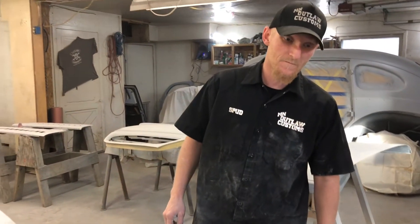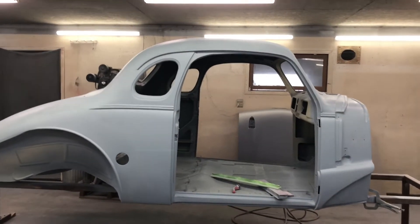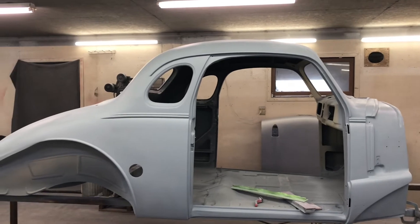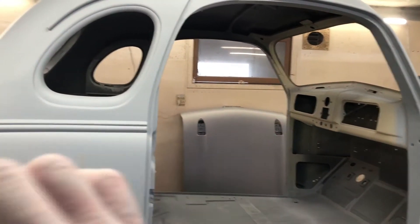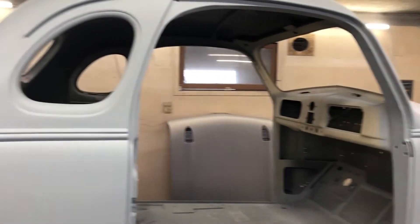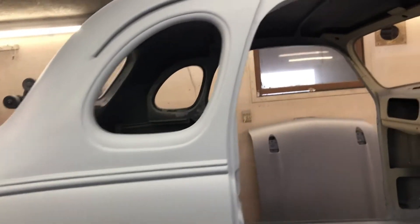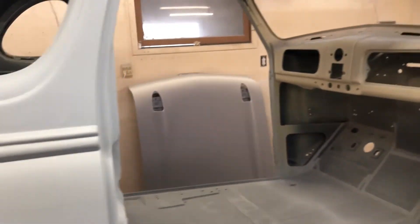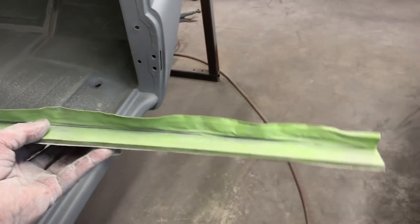So we got this car to finish up, like I was saying last night on the other video. And as soon as we get this thing painted — and it's looking really good right now — the first thing we'll do is buff it out. We're going to wet sand it, color sand it, which is wet sanding, making it where it's all block sanded real perfect. And then when there's no gloss on the clear coat, we'll buff the thing out all the way down to like 3,000 grit paper. So by the time we're done, the paint's going to look like candy on here — it's going to be juicy looking. And I've got Lucky Matt's blocks. Been using the hell out of those. These things are amazing.